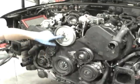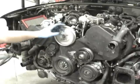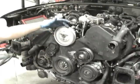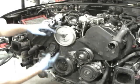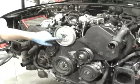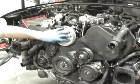So you can either find a 9 millimeter Allen, or like I always do, you can leave the belt on and crack them free, hold it with your hand, wedge something through the holes, get a huge massive pair of channel locks and put a rag around it so you don't score it, and undo the 6 millimeters. Or my favorite is I use an impact and just buzz them off. So I'm going to undo that.